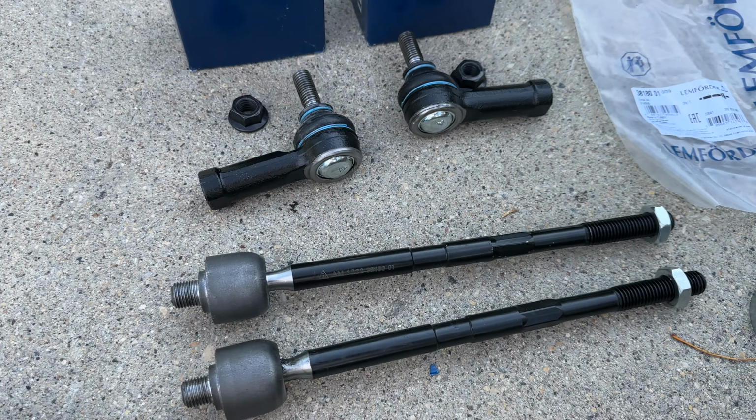I didn't use a torque wrench here. I just went by feel and I overdid it. It was really easy to break this bolt, unfortunately. It broke in half. The piece that's in the rack, actually, I was lucky, it just came out using my fingers. And this bolt will set me back for at least a few days because none available locally.